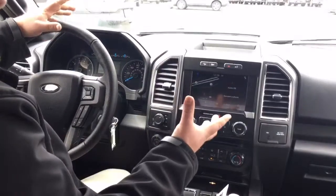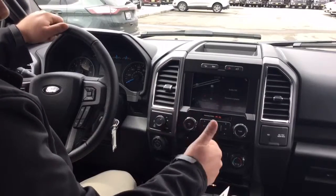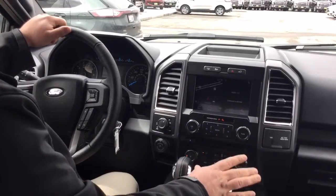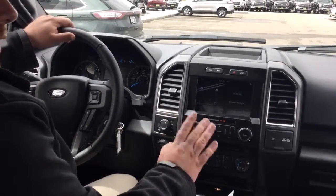All right, now that we're inside the truck, it must stay running the whole time while we do this process. We're going to be naming the trailer. You also must make sure that your truck is on a long straightaway, because when we calibrate it later, we're going to need to be in position just to drive it straight. We're also going to need to name the trailer.